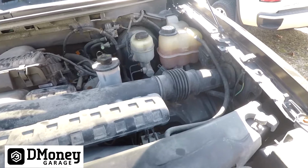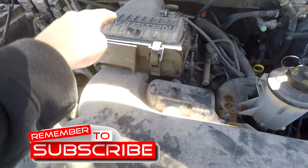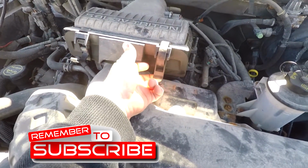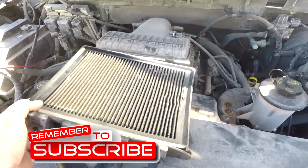Next up is to locate the air filter. Inlet air is coming in this way. It goes through and down into the engine. So your air filter is under here. Release these two tabs. Right there's the air filter.